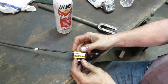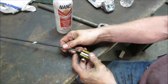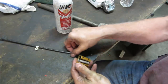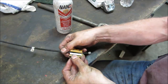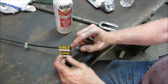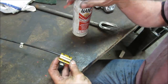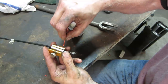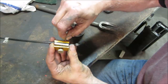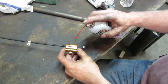So this thing is called a cable oiler, and what it does, it has a rubber barrel on the inside of it, and it tapers like an ice cream cone, for lack of better definition. And you crank down the clamp around it, it closes up, seals off the cable, and seals off the jacket, and then it allows you to take any kind of spray nozzle and put it in the hole. I mean, hopefully it will fill the jacket up in between.